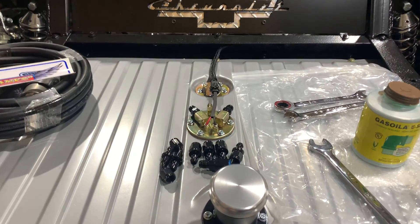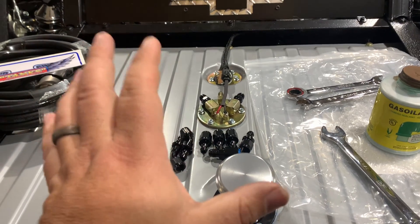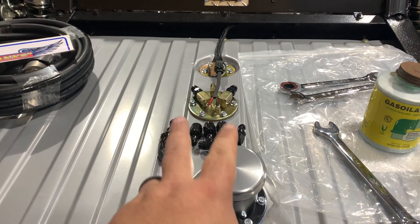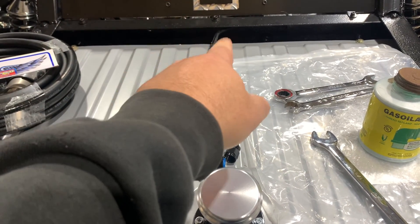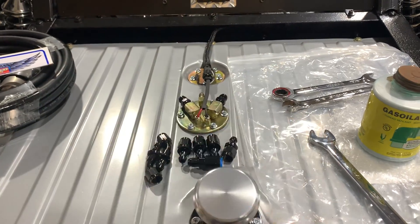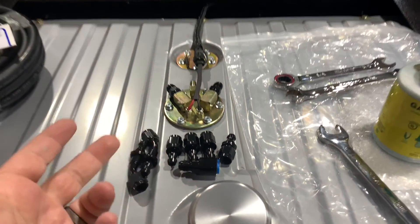So for the next step, unfortunately I think we're going to have to pull the tank out because I'm going to route my send and return fuel lines through that crossmember right there — I think I'll cut a hole, start a grommet, and go right through there. We could put bulkheads on our custom Chevy plate or in the crossmember itself and attach AN fittings with a 90-degree elbow, but that's another point of connection and another place for leaks, so I figured let's just run the hose directly through the crossmember. It'll still look nice and neat, and it's just two less places for leaks to occur.